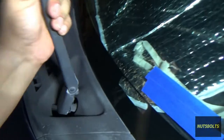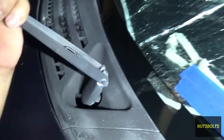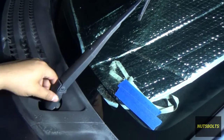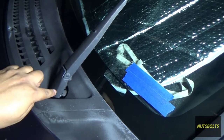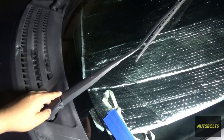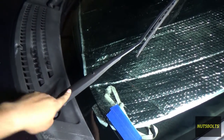This arm has also been an issue in the past because it never really wiped the windshield as it should. I kind of figured it might be because of this spring in the back — a lot of the times when these springs start losing tension it starts leaving streaks. But in my case since it just got pulled over, I'm pretty sure the whole issue was down here with the splines to begin with.